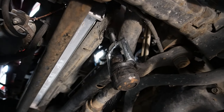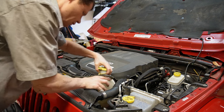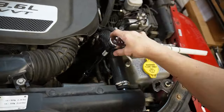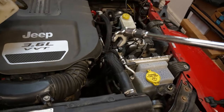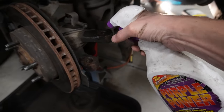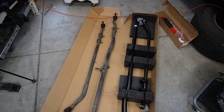I got that puller on there, but I needed to get a better angle at it. The coolant fluid overflow reservoir just pulls straight up — got that out of the way. I set up a half inch socket with some extensions and a crow foot on the end, was able to reach down, get the tip of that puller, and was able to pop the tie rod off there. And there it is. So that drag link to the Pitman arm — be prepared for a little bit of a battle. We'll clean all the grease off the old knuckles.